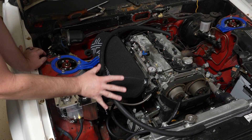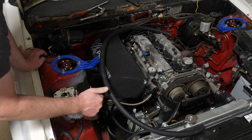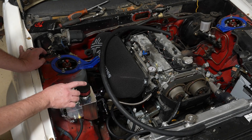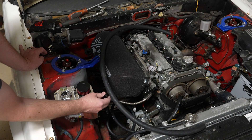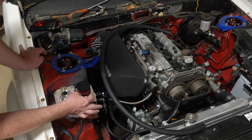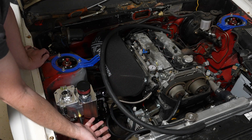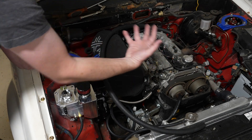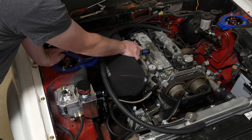Now let's show how you should ideally hook this up with a stock ECU and stock manifold — that's going to be the recirculated catch can. For a stock ECU setup, route your PCV valve — your primary source to catch oil — to an oil catch can like this JSP Fab all-in-one unit. You'd block off the other port, and then out of the top send it back to the intake manifold and you're good to go. However, under high crankcase pressure — say at wide open throttle — you'll get pressure coming out of both vents. So you'll catch oil vapor from the PCV side, but from the fresh air vent it's going to dump straight into the intake right into the throttle body.